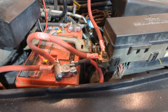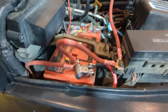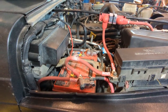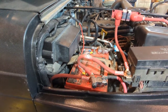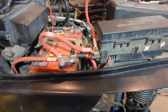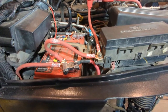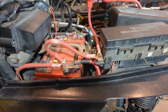And again, that's another problem where over here with that secondary terminal there, it could create a little bit of an issue. But overall, definitely doable, workable, makes it easy. The only other exception, like I pointed out before, is the secondary wire that goes down to the starter. You'll have to separate those to make sure you can keep that. Other than that, everything else is good.